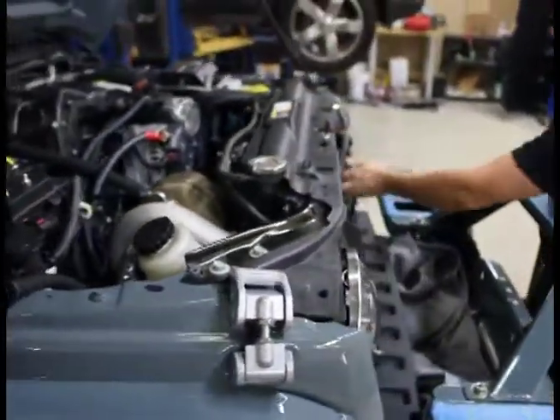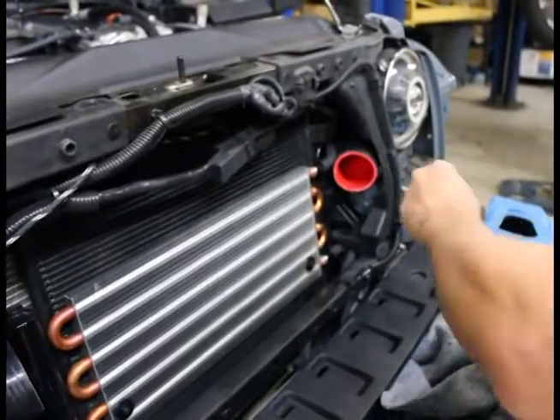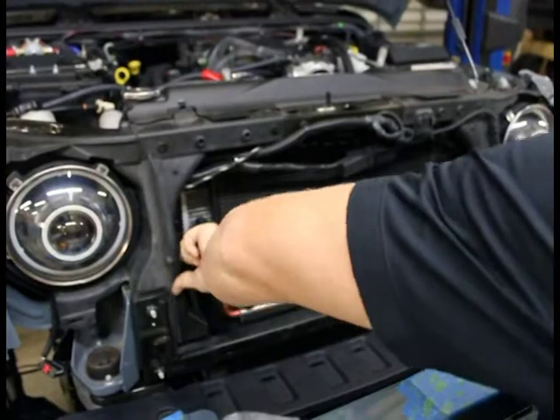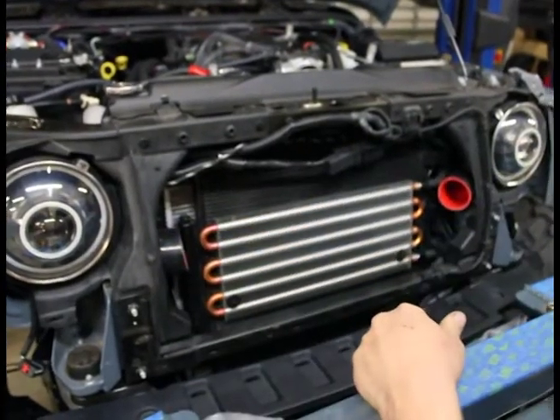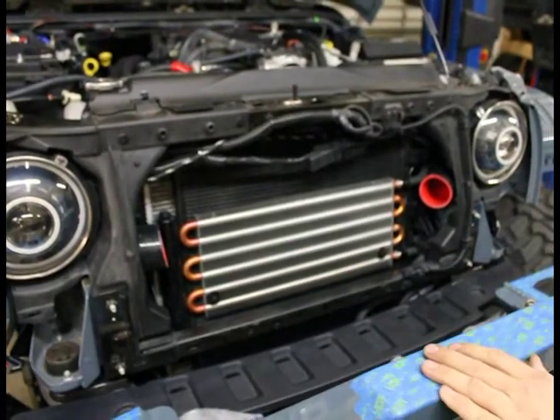The other side — I'll just push this hose through for now. I'm going to leave this excessively in there. I'm going to drop the intercooler on and slide it into this fitting here. It'll pull out — should have enough room. After that we'll put our bolts in, do the next side, and the front end will be done.